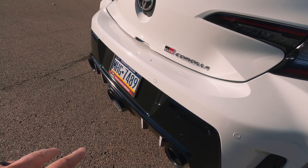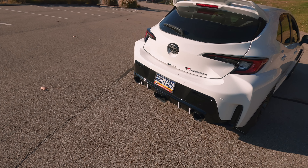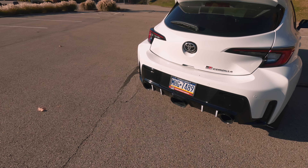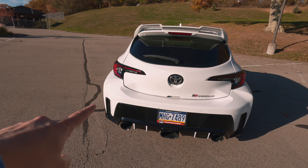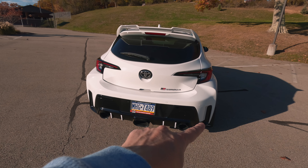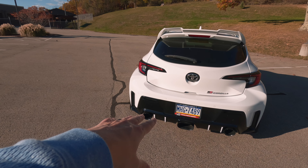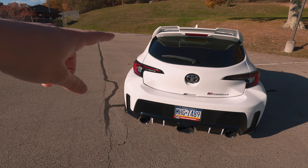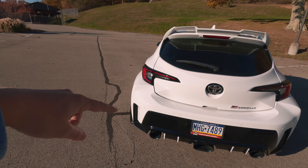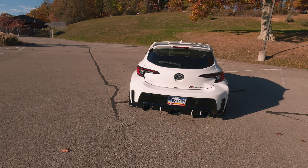There are a couple dots in here, not really a big deal, but I'd recommend clay-barring your car first because I think that's just some tar that I should have taken off beforehand. If you're just dropping into this video and haven't seen my last video, I just replaced the brake lights on here — they were reflectors before. I went with smoked black to blend into that gloss black rear diffuser and wired them into my brake light so they work as parking lights and brake lights as well.